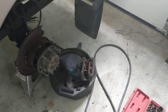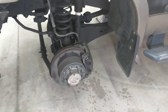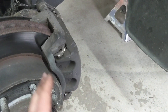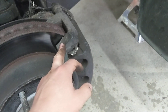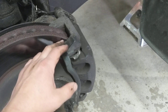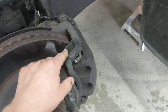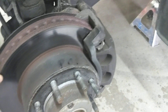I've experienced this three times. The second time was with the front — I did all new pads, rotors, and calipers 20,000 miles ago with Centric Premium. After about 5,000 miles I had trouble with a front caliper and found the end of the piston was broken off. So I replaced both front calipers with NAPA Premium calipers — they come painted black, which is nice — and I haven't had issues with those since. I didn't want to replace all four calipers after just 5,000 miles, so I left the rears alone.